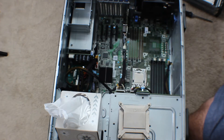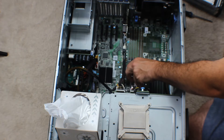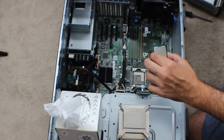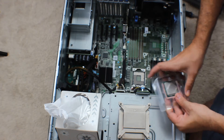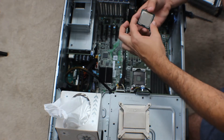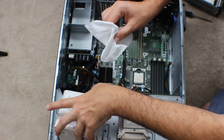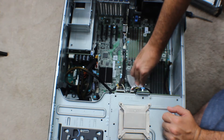Make sure you get all that thermal paste off. Once you're pretty satisfied with it, you can go ahead and pull that out. Remove your CPU carefully — I like touching just the ends of it. Then you want to find a static bag or a CPU holder and place it in there and seal it up. Then we're going to grab our new CPU and place it down. You want to make sure your notches line up with the notches on the CPU board. And since this is a used CPU, there's some thermal paste on it, so I like to clean that and get all that old stuff off, because we're going to put brand new paste on.